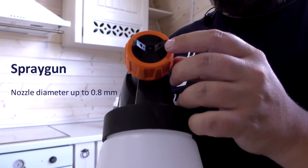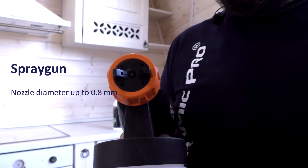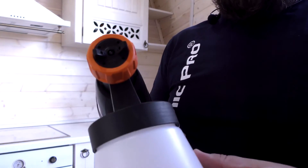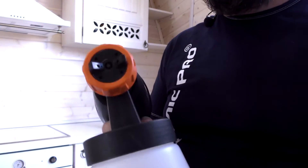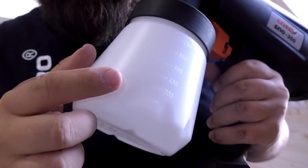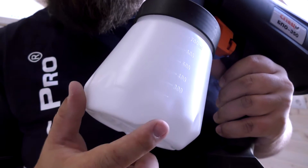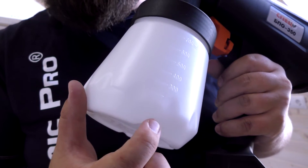In order to apply Ceramic Pro Strong, we'll use this spray gun. Its nozzle is 0.8 millimeters in diameter, which is quite large, but I've consulted with Ceramic Pro on this subject and was told that it's suitable. Naturally, you can use spray guns with adjustable nozzles to use the product more frugally, but this simple one will do just fine as well. The spray gun's container can hold up to 800 milliliters, but we don't need that much — 100 milliliters will be enough, if not too much.